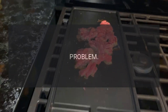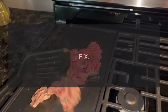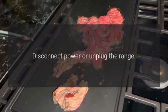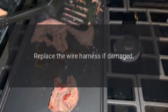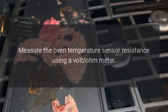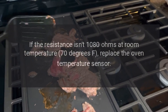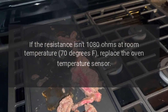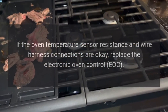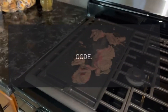Code F-3E-2: Fix — reconnect the wire harness if loose, replace the wire harness if damaged. Measure the oven temperature sensor resistance using a volt-ohm meter. If the resistance isn't 1080 ohms at room temperature (70 degrees Fahrenheit), replace the oven temperature sensor. If the oven temperature sensor resistance and wire harness connections are OK, replace the Electronic Oven Control (EOC).